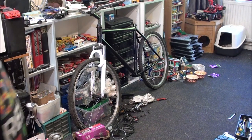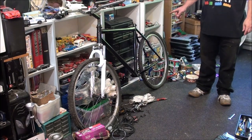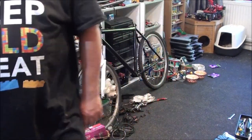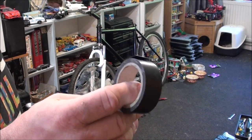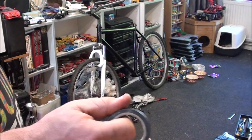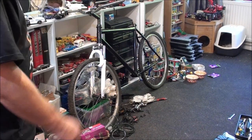I've not pumped the tyres up yet but they have got replacement tyres on — I now have a pair. I've had to replace the rim tapes on both wheels. What I like to use, which is a good quick trick, is just some PVC electrical tape. I've even seen this suggested on bicycle repair groups on Facebook. Some people say go around once, some say two or three times — I like to go around at least twice, just to be sure. You can use whatever colour you like because you won't see it when the tyre's on.